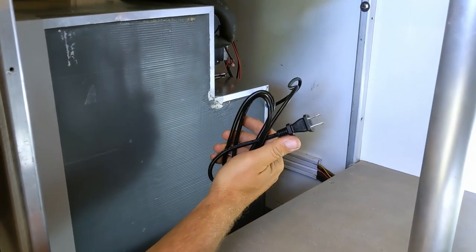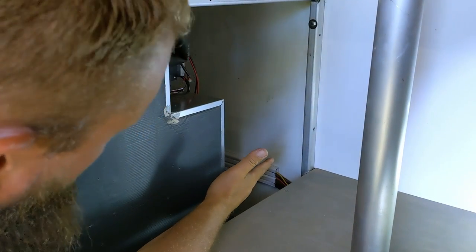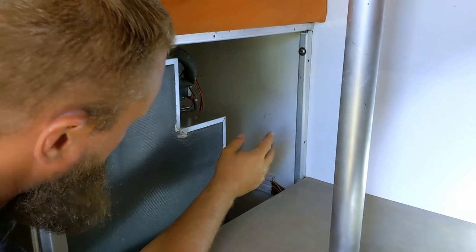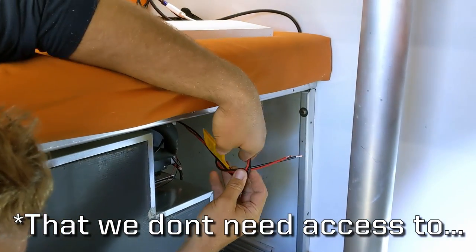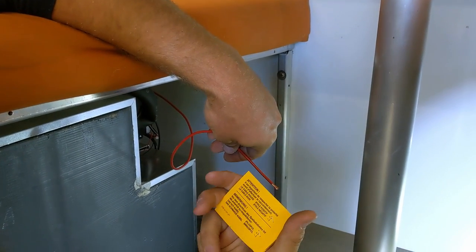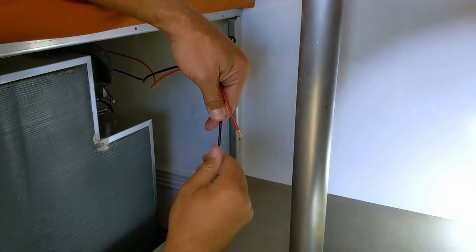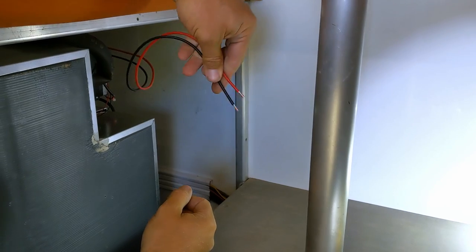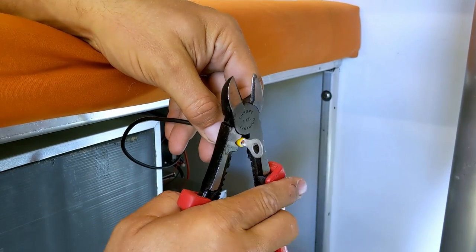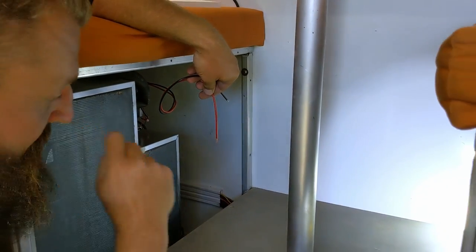Next is electrical. This unit, to my surprise, came with a 110 adapter — I have no use for that right now, but I might in the future so I'll leave it back there. We do have a ton of space back here and I'm going to utilize it by relocating our inverter and some other equipment back there. But the priority right now is a 12-volt power cord. They have a great yellow placard in four languages reminding you that negative is black and red is positive. You should keep these wires as short as possible, and if you need longer, follow the manual for wire gauge. In my case, I've got a grounded aluminum chassis right here, so I'm going to put this eyelet on and ground it right on that bolt. Then this wire just runs up to our fuse block, which is just behind this dinette seat.